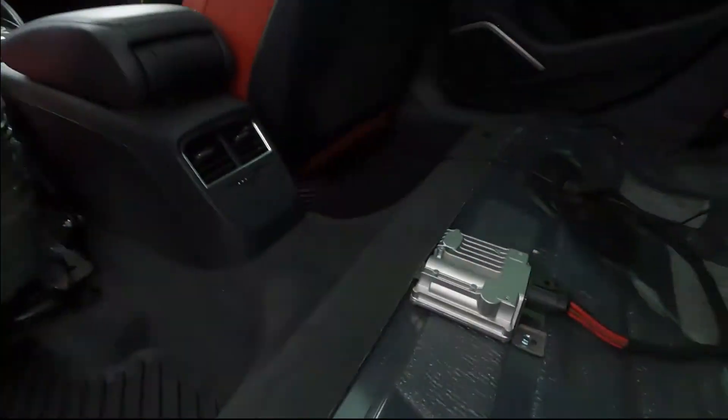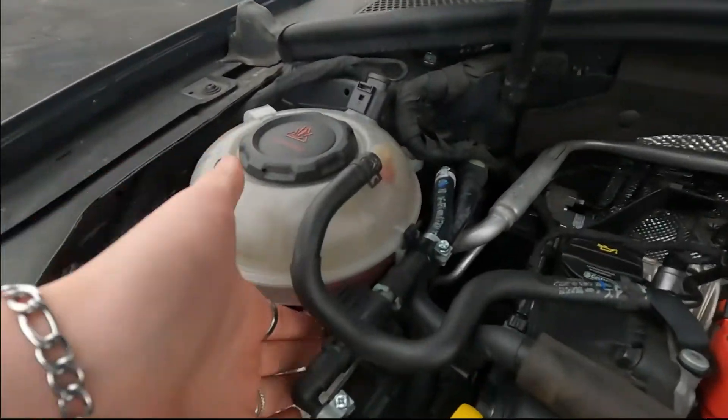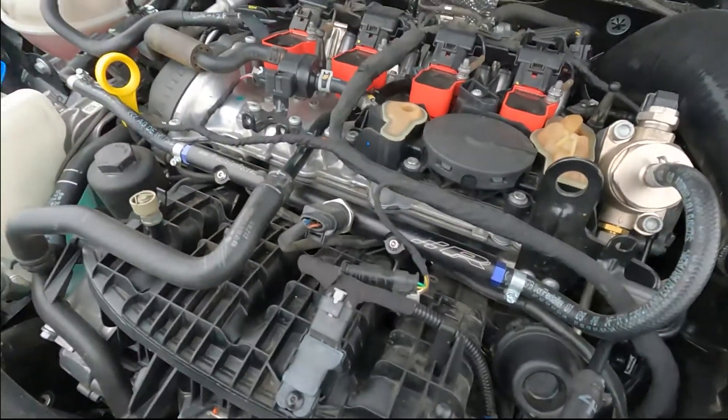Here's the module — that's hooked up to my brushless drop-in pump, and that is how I'm able to support the full E85 capabilities. I do have stock high pressure, but to help out with that, that's the E85 sensor here. Additional lines to the MPI for Precision. I think that's about it, boys and girls.